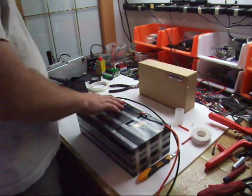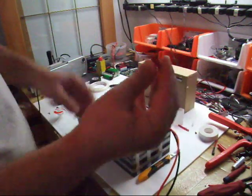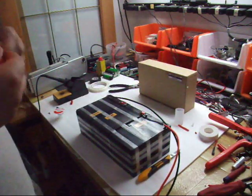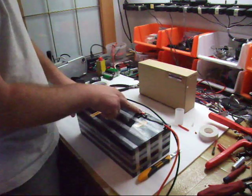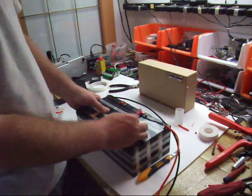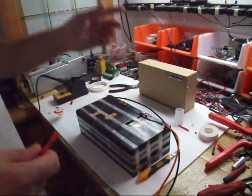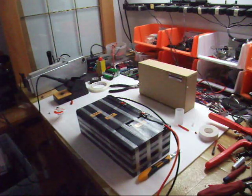Now, I soldered on all my connections. There's no problem with using some of these connectors — they're basically flat tabs and they just push on there. If you don't have a soldering iron or you're not comfortable soldering, you can use these and there's nothing wrong with them. The only thing is make sure you put a good loop of cable from one to the other and tape down all your cables, because if these wiggle at all when you drive, they're going to come loose and your controller will cut out and you'll have all kinds of problems on the road. I just find that solder is permanent — it never comes loose unless you want to take it out, which is a piece of cake.